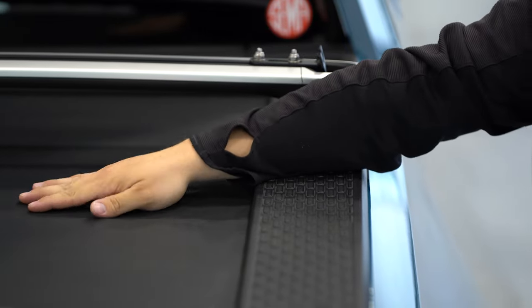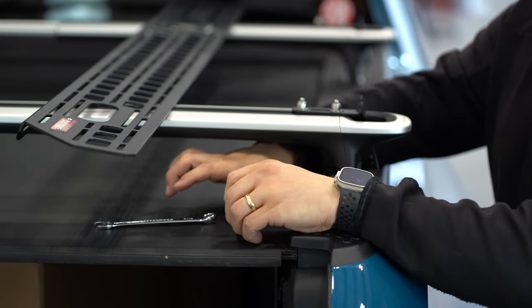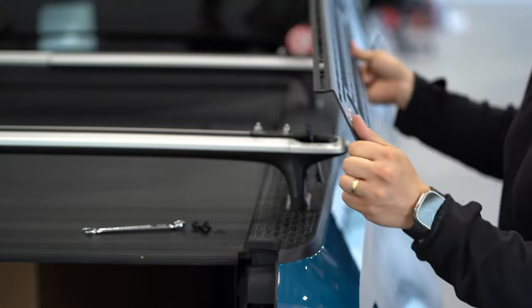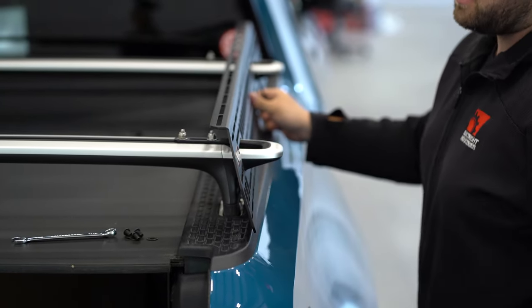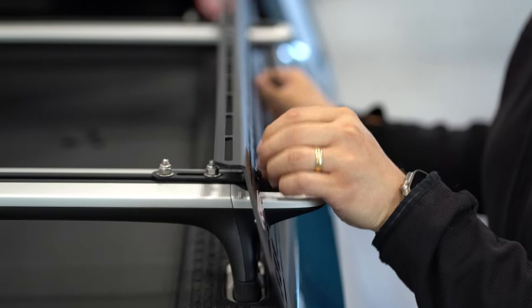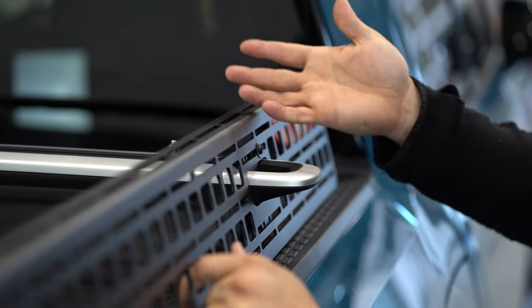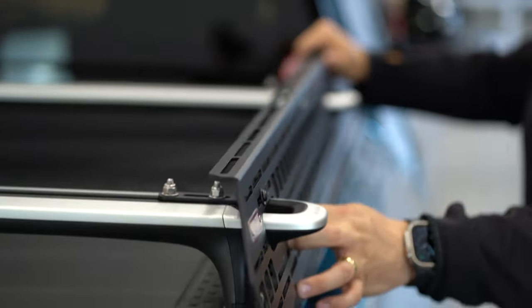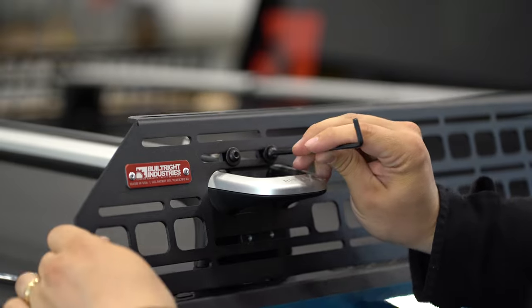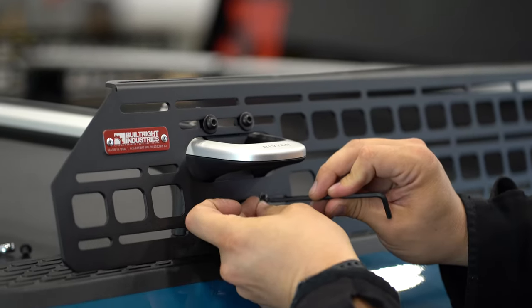So the next step, we're going to put the panel on here. I'm going to move my hardware into place so that it's an easy reach. We've got our panel in place. Then we're going to get a couple of the small machine screws with a washer started — one in the rear and one in the front — just so that it's easy to grab once we're holding the panel in place. We're going to move the panel into position, being careful around your crossbars. I'm just going to use my fingers to get that button head screw started, the goal being that the panel doesn't fall onto our truck. I'll do the same thing up front, just getting one of those button head screws started. With that, we can maneuver the panel around and get things lined up the way we like. Now that the panel is on there and it's not going to fall, I'm going to get the rest of the hardware started loosely.